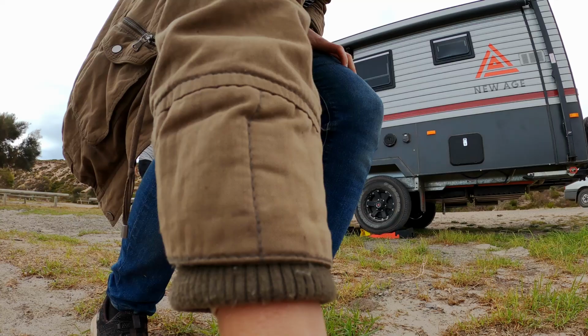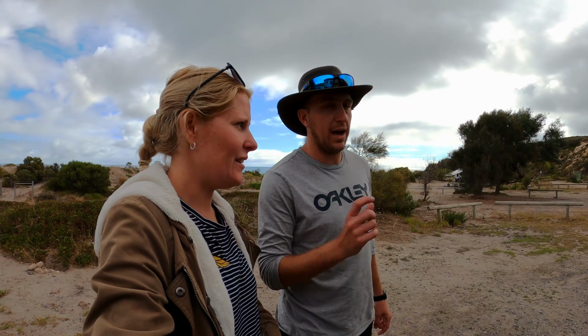Right, so always put the chocks in and then put the handbrake on the van before Mark takes the brakes off the car. Yeah, because it's always going to roll a little bit, so we allow for that when we've gone up the ramps. Kind of will take me over just a little bit so we can roll back in onto the chocks. Yeah, doesn't always work out.